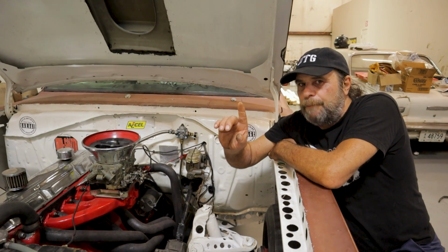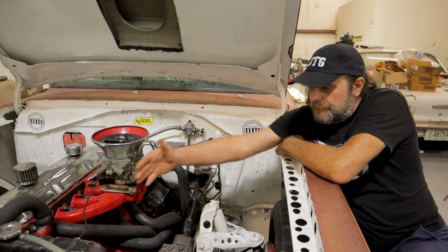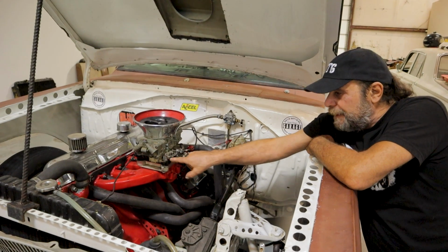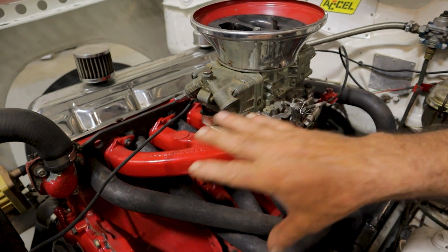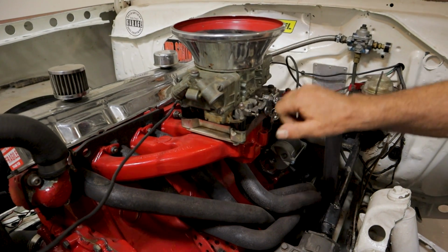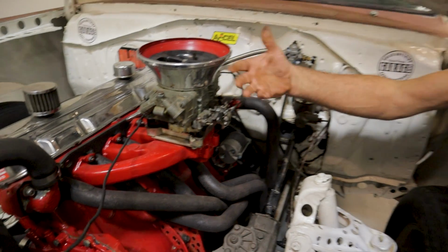So it dawned on me at that point, it's the design of the intake manifold and how I'm treating this thing that's the problem. See, on a typical V8, the intake manifold is sandwiched between the two banks of the engine. And so there's always radiant heat coming up from the block and the heads, warming the intake. But on this thing, it overhangs nothing. And so when the engine sits for, let's say, 10 minutes or so, the engine itself, the block, the heads, everything is still warm, but the temperature of the intake manifold drops way down. And then I'm aggravating that situation by squirting a bunch of raw gas, which is going to have an even further cooling effect on the intake manifold, and aggravating that situation.